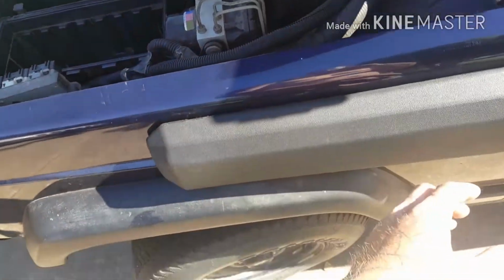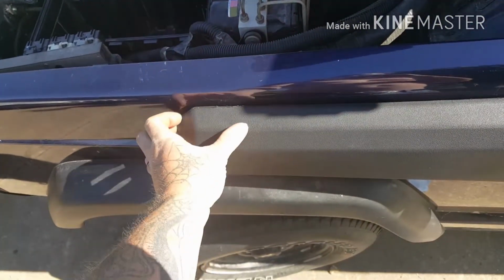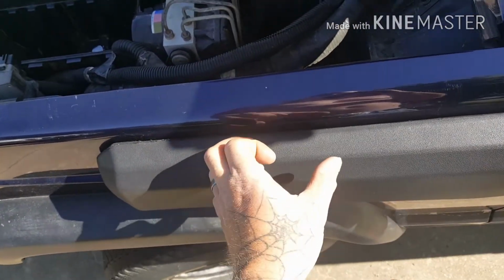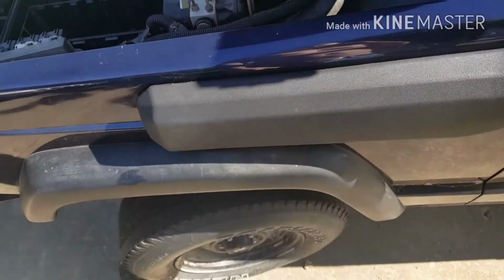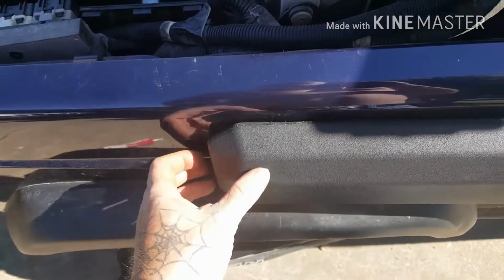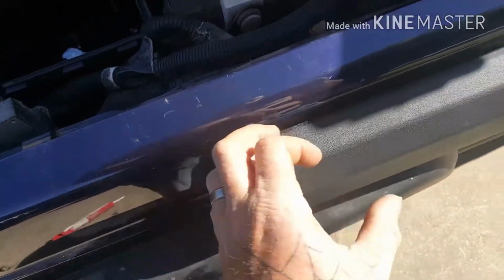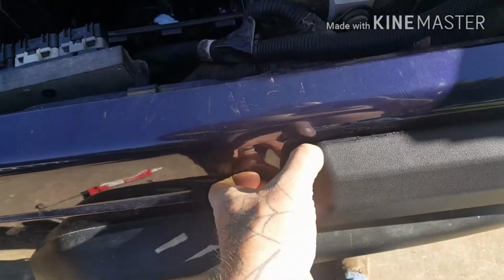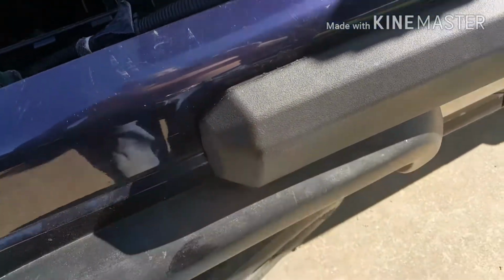I made this hole first, even though I had the template showing me where these bolt holes were. I made this hole first and then actually slipped it in and made sure the bolts were going to fit. I had the studs in these and Loctited them, made sure they were going to fit up close to these holes, and they did, kind of, sorta. So I ended up changing that a little bit. The reason I'm saying to make this hole bigger is because if there's a bind between these bolts, or if it's just a little bit curled and has to fit too tight, it will press the whole fender in and it won't get you tight on the front end.